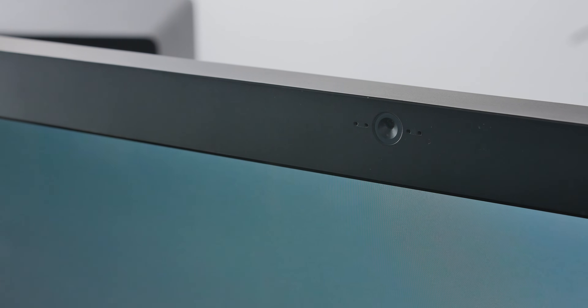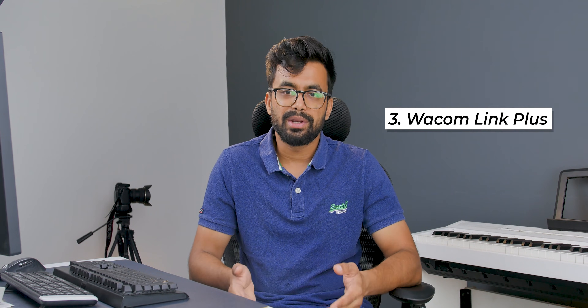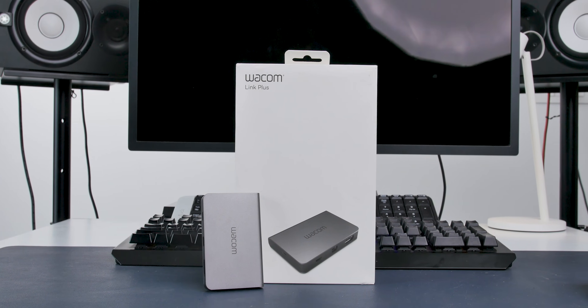Like here I have a webcam, built-in speakers, and USB-C ports on the back for connecting peripherals, so we also need to find a way to add USB data to this USB-C display output. Luckily there is one device that can help: you might have heard of Wacom — they make pen tablets for digital art. They have a series called Cintiq, which are pen tablets with integrated screens. To connect those via USB-C, they provide a device called the Wacom Link Plus. This can take DisplayPort or HDMI signal and USB data from your computer and convert it into a single USB-C connection, and that is exactly what we need — something that takes video and USB signal and merges it into a single USB-C output.